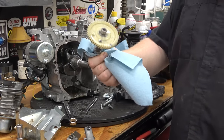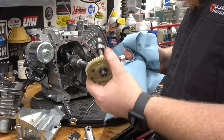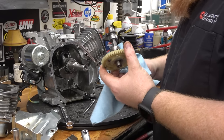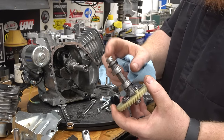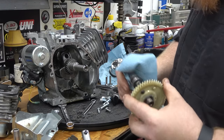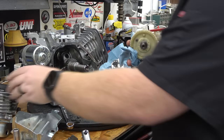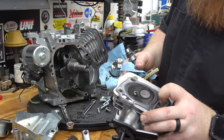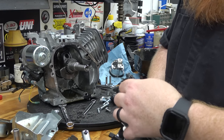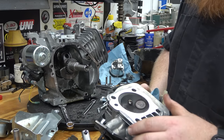This engine had a plastic cam gear, so it'll be nice to replace. They use plastic cam gears for noise reduction, but I don't like them. I've got to test the journal size to see if it matches a HEMI or non-HEMI — I'm assuming it'll match HEMI but I'm not sure. This is a different type of HEMI setup. It did have a super thin head gasket, which is really nice — that ups the compression over a thicker gasket. We'll be putting another thin sheet metal head gasket on it; those are about ten-thousandths of an inch.